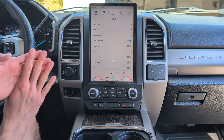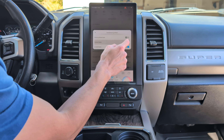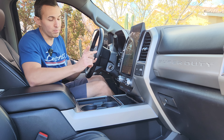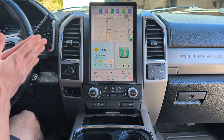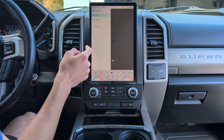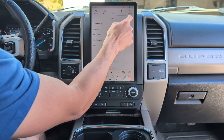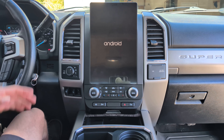There was still one more issue — we didn't have our heated and cooled seats. Go back one option to Seat and Steering Wheel and enable heated and cooled seats via the toggle switch. After making any changes, click Save and Reboot. One thing I wasn't a fan of was the default boot logo showing a Ford Ranger. Since this runs Android, you can swap it out: go to Settings > User > Boot Logo, find the thumb drive plugged into the screen, select your image, and it successfully applies. Now the Ford logo appears. I'll leave a link to this image in the description.